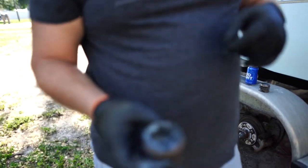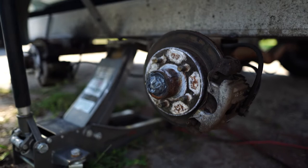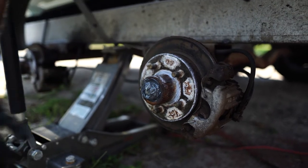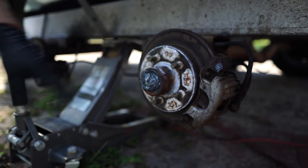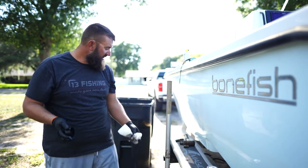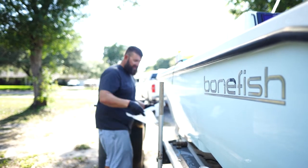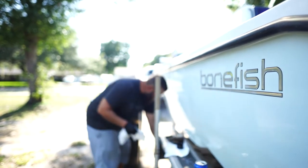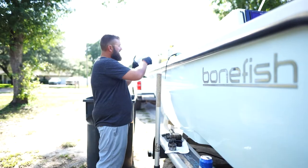There's a cotter pin, a nut, and a spacer — that's what holds this whole entire hub in. We're going to clean this up on both. Once we get the caliper off, the hub will slide right off and the new hub goes back on. We'll clean out the buddy bearings real good and put fresh new grease in them. You can never spend too much time getting this clean — you want all your grease to be nice and fresh.